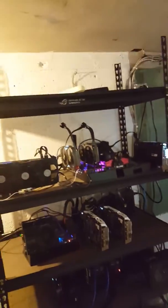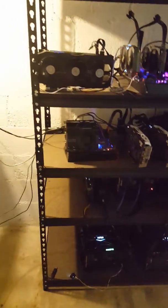Being able to pull 1,500 to 1,800 watts safely gives you a lot of headroom. Each one of these is a 1,000-watt power supply, and a four-card rig is only gonna pull like 600 watts. I have one set up to a meter here — this one has five GPUs on it and it's pulling 763 watts. That's a rig with a 1070 and four 1070 Ti's. The 1070 Ti's really don't draw that much power.